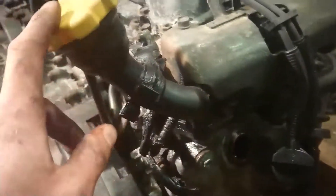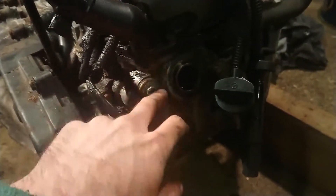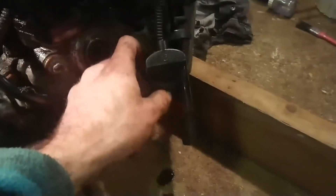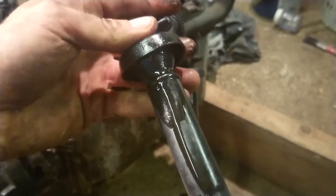What I was a bit concerned about is that as soon as I pulled the plug leads from the head, there was oil pouring out of where they connect — running down onto the floor. I notice the oil filler actually connects straight to the rocker cover, so I don't know if there's an oil jacket that runs around the top of these. I've never come across that before. Answers in the comments please — should I be concerned? I'm not too familiar with Subarus.